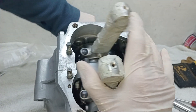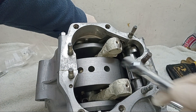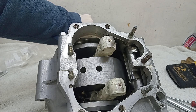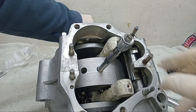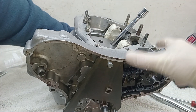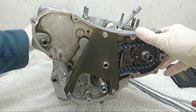I'm going to turn the crankshaft round until these balancing holes line up — these holes are drilled when they're balancing the crank to remove weight — so that the socket extension fits nicely in there to lock the crankshaft.